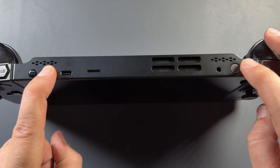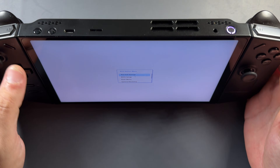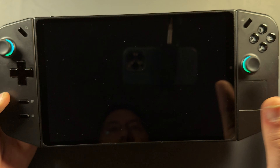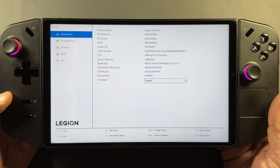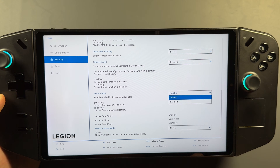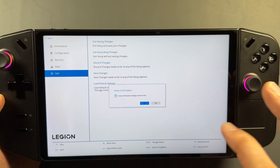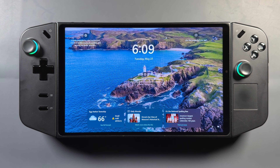To do that, we're going to hold Volume Up and then turn on the Legion Go. Keep holding Volume Up until we get into the menu — it doesn't take very long. Once that pops up, you can let go. Now we're going to click on BIOS Setup. Once we get there, you'll see a tab on the bottom right that says 'More Settings.' Over on the left, click the Security tab, scroll down toward the bottom, and you'll see Secure Boot — it should be enabled, and you'll want to disable that. Then click Exit on the left-hand side and Exit Saving Changes. The device will restart, and this won't allow you to use your PIN — it would be password only. But I'm ready to install SteamOS, so I'll just shut it down and go back into the BIOS menu again.